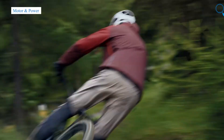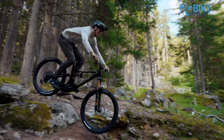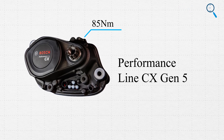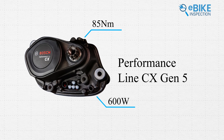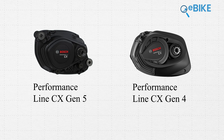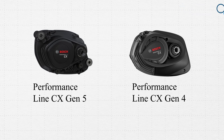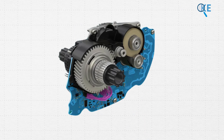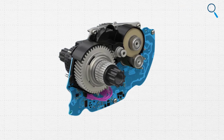Now, the most important thing: motor and power. If we talk about the Gen 5 motor, it maintains its core technical specifications and delivers a solid performance with 85 newton-meters of torque. This motor has a peak power output of 600 watts, which is almost similar to its predecessor, but the setup provides riders with an impressive 340% assistance. While the external design looks similar to Gen 4, there are significant improvements under the hood. Bosch has adopted a two-bolt mounting system, similar to that of its lighter SX motor, which simplifies installation and enhances frame design flexibility. Additionally, Bosch has updated the gearbox design, which successfully removes the clacking noise that was present in previous models.